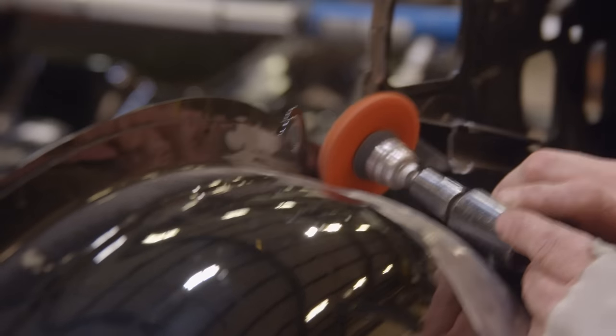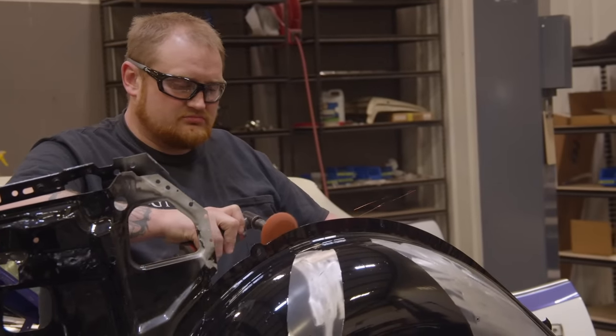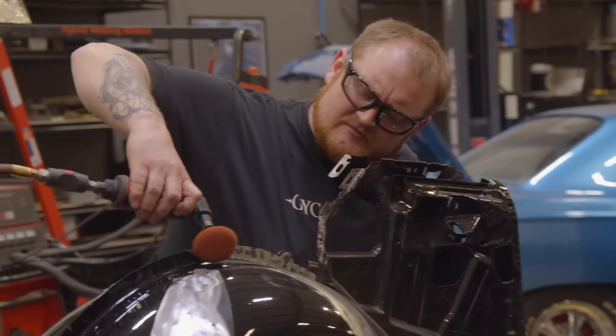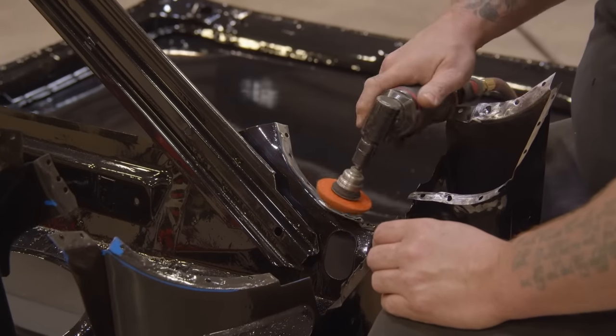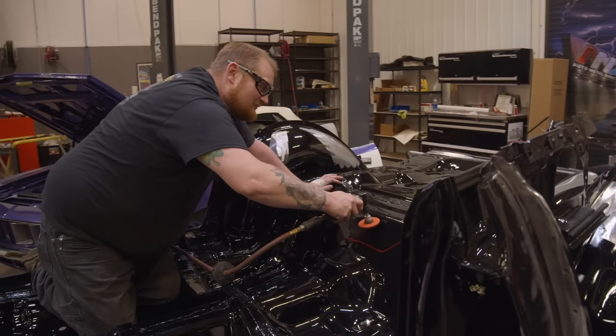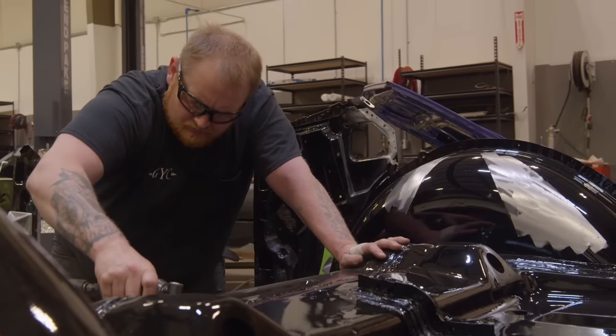Now, before we can actually put the roof down, we have to prepare the areas that we just got through painting for welding. So when the roof comes down, the roof inner structure pieces, the ones I don't make anymore, are going to intersect with the inner wheelhouse. That's all got paint on it now, so we need to grind that paint area back. We need to grind it back off the roof piece. Wherever there's an intersection, whether it's the quarter panels meeting the roof inner structure, the Dutchman panel meeting the rear wheelhouses, the A pillars meeting the A pillars, B pillars meeting B pillars, all those areas, if we're going to do welding on them, we have to go back through, clean all that paint off in those intersecting areas, and put some weld-through primer on them.